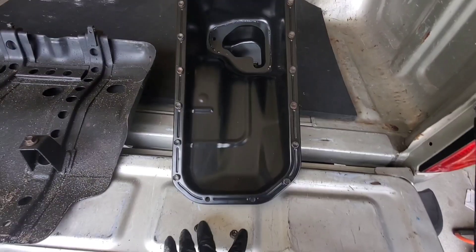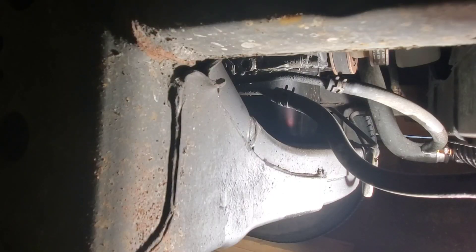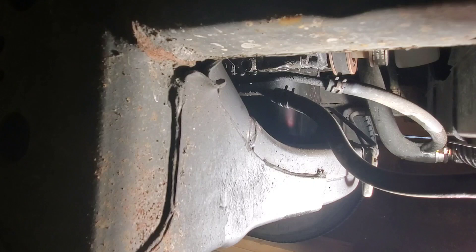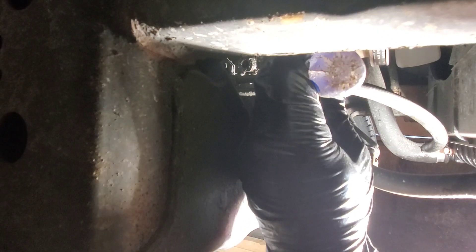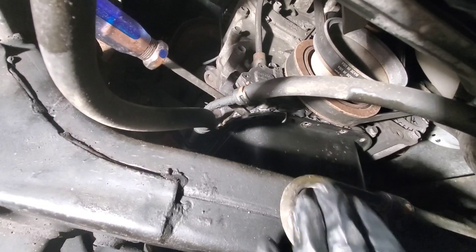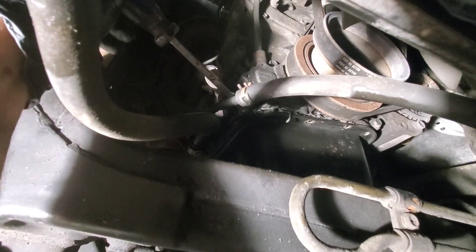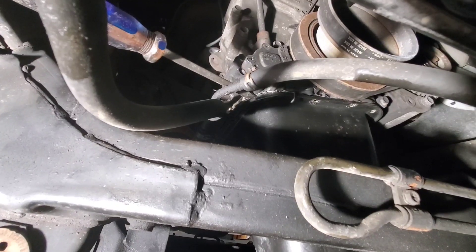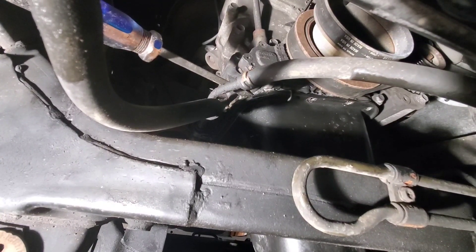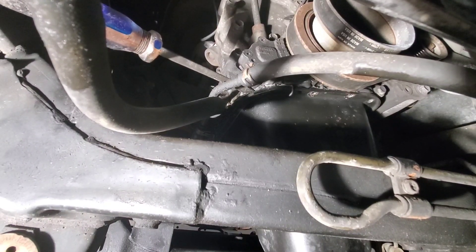So our new pan — I've put in all the bolts. Make sure as you go along that you have all the parts before you continue. Now it's time to pry off the oil sump pan. I'm going to take a big flathead screwdriver and go in between. The key thing here is to be gentle — you don't want to scratch the mating surface. You can see where I have entered the pan between the two where they meet. Now that the flathead has gone in far enough, all you have to do is pry gently on the pan. Work your way around, pry with a screwdriver elsewhere, and try to pry with two screwdrivers at the same time. Be gentle — you don't have to be aggressive — and the last thing you want to do is scratch the mating surface on the engine block side.